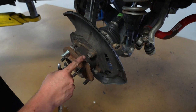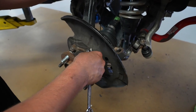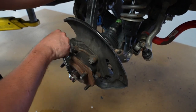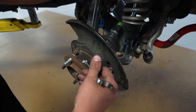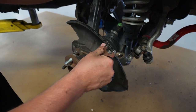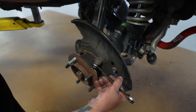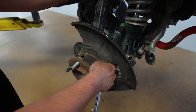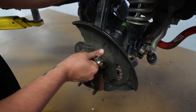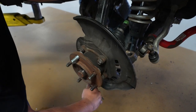These four bolts run inward and outward, so to get them all the way out you have to back them out one at a time very slowly — go to one, back out a little bit, then the next, back out a little bit. Make sure you don't get your wrench stuck. It's a 17-millimeter wrench. Put it on your bolt and pull it. Do that for all of them, break them free, and then slowly remove them.